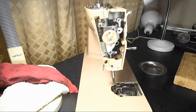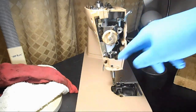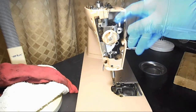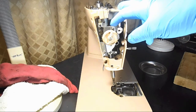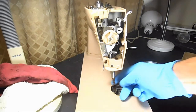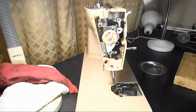I strongly recommend that before you try and move any of the presser bar assembly and systems, you remove the needle bar. I made a video on how to remove and replace it — I'll try to put a link at the end of this video. You really should remove the needle bar first. You also need to remove the presser foot and the thumb screw that holds it on.